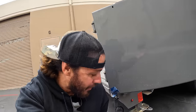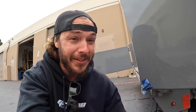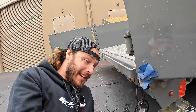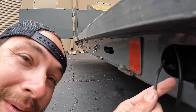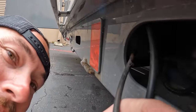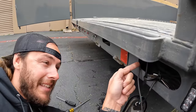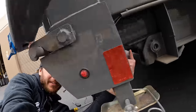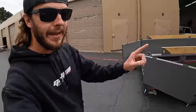For fishing wires on this side we got a little more clever. Since there's not a bunch of wires on the outside of the frame like the other side, I figured if I could get the drill bit inside this light pocket we'd just drill it there. We were able to, and this is our fish line — it came all the way through, and everything's going to be contained inside this light pocket. There we go, we got wire!